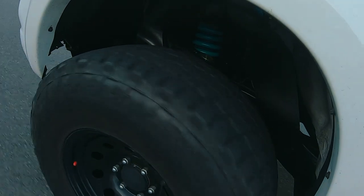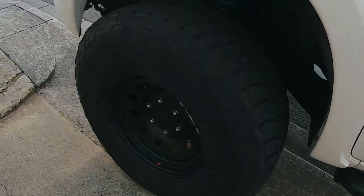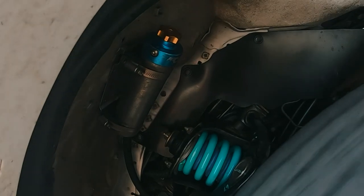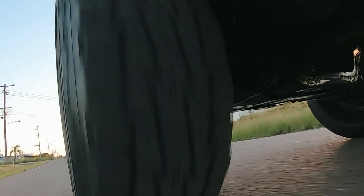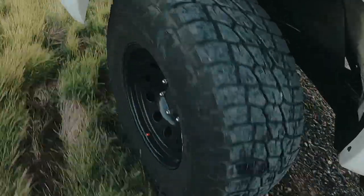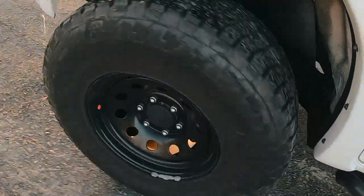This combination is not going to be legal without a mod plate as it's more than two inches over the factory tyre size. In my opinion this is the best size upgrade without losing too much power — you don't have to do a body mount chop to fit this size. This size is skinnier than a normal 33 inch tyre, which would be 12.5 inches wide, as opposed to this tyre which is 11.5 inches wide. This gives you that bit of extra room and makes sure you get full steering lock to lock. These will fit inside the guards with a positive 10 offset and line up with your SR5 flares. If you don't have an SR5 they may poke a little bit or you might have to install some aftermarket flares. I have 60mm flares so the zero offset fits exactly in line with my flares. It is possible to fit larger diameter tyres but it starts to get a lot more expensive past this point, which is why I chose to stay with this.